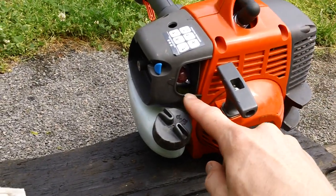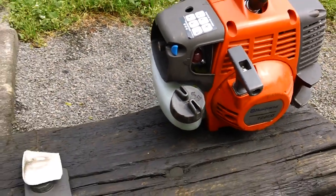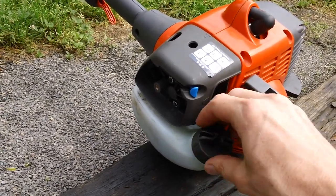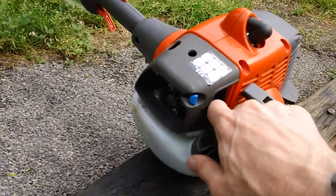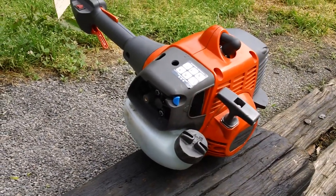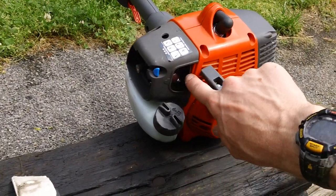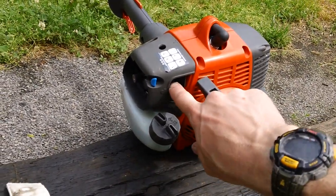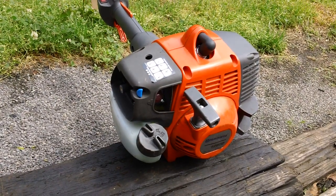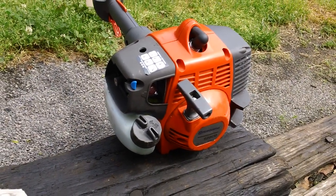You can see the new fuel line down inside — there is a new fuel line on the machine. We also had to put a new fuel filter in here. So there's a whole fresh tank of gasoline in here right now, filled all the way to the top, because I typically like to let the machine sit overnight for about 24 hours to verify it's not going to leak. So: new fuel lines, new fuel filter, clean tank, new carb assembly, new intake gasket. You always want to replace the intake gaskets because they can stick to the carb and pull apart when you remove the carb — always install a new intake gasket when doing a fuel system overhaul.